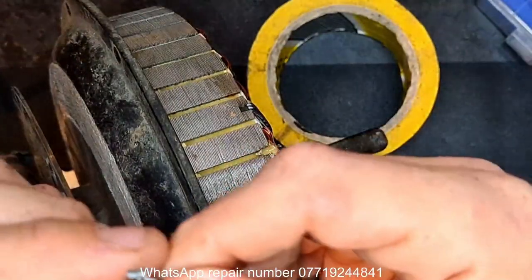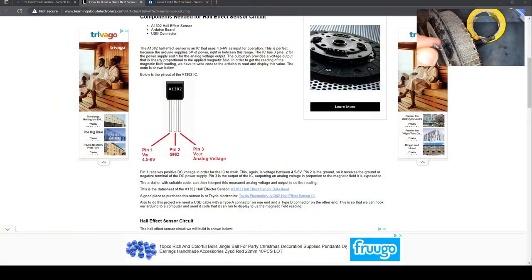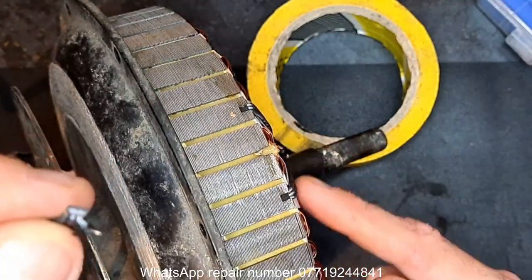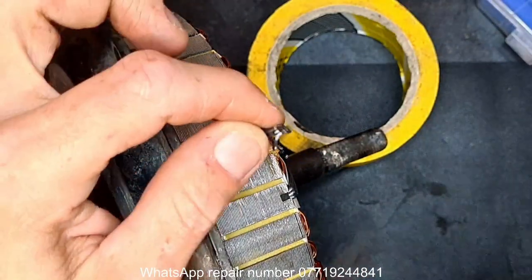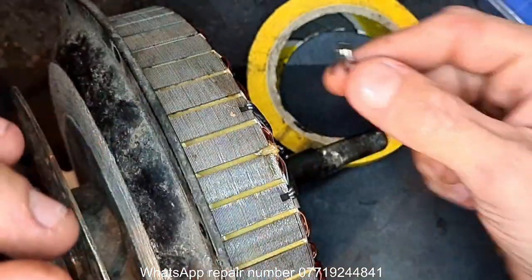But in most cases, the beveled edge at the front is the sensor. And on most spec sheets you look at, you should be able to pull up a better picture with the bevel. They demonstrated with these sides here, there's the beveled front. I think that demonstrates enough, to be honest. So yeah, that's just something to watch out for. It's mainly in the ones with the white green boards that's printed there sometimes, because the circuitry on the actual board, the way the PCB traces are laid out, they account for the rotation of the sensor and they swap the pin power accordingly. Anyway, just keep an eye out.